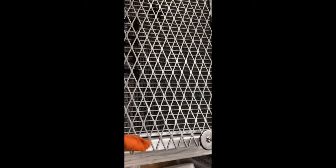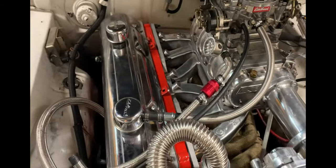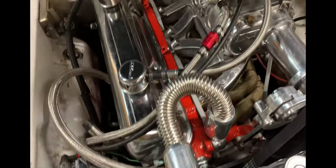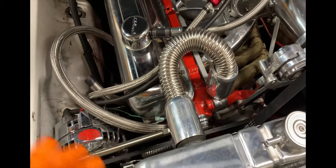It's giving a little rattle. I may want to come back and do a neoprene lining down the sides later. I've got my radiator hose here — it's 5/8 stainless wrap, kind of cosmetic, but also nice protection since for a while I'm not going to have a hood. If all my hoses are generally protected that'll be better for longevity. I've got my lower hose attached. I got the radiator in — look at that clearance! No way a fan was coming in here. This was all mapped out. I knew the dimensions of where this was going to come out, and even though it's really flush with the factory belts and pulleys, there's always a way to make it work.